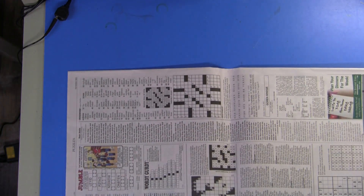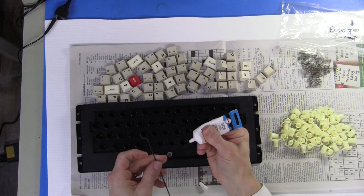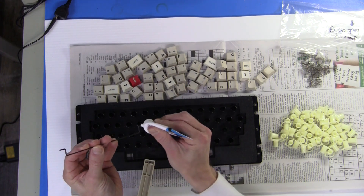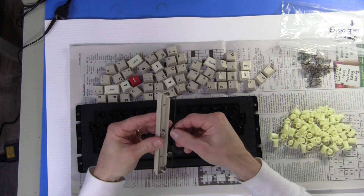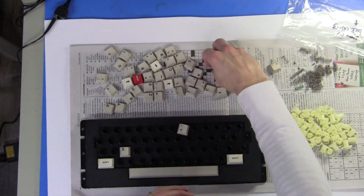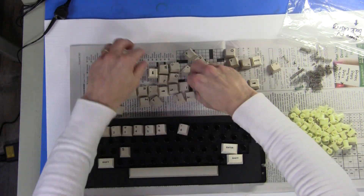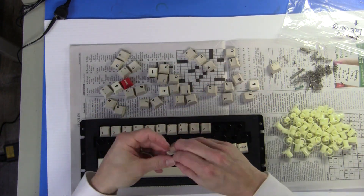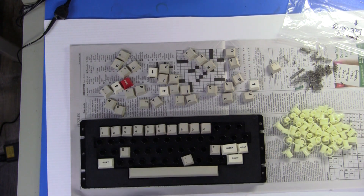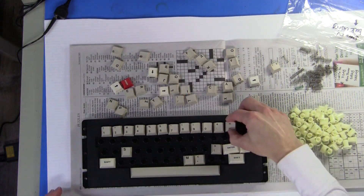While the glue sets up, I went back and scrubbed all of the key caps using a toothbrush, dish soap, and warm water. I'll put a little bit of silicone grease on this metal hinge piece for the space bar, pop it back in place, and make sure you get the metal rod under the two plastic holding tabs in the black plastic. The keyboard and space key won't press correctly if the black metal rod isn't under those two little holding pieces. I scrubbed each of the five faces of the key, soaked the white nylon spacers, and scrubbed the black keyboard piece with a toothbrush as well — everything came out looking quite good.